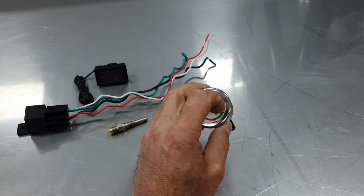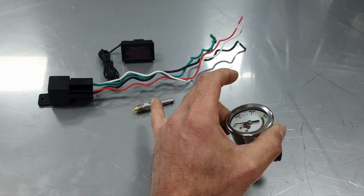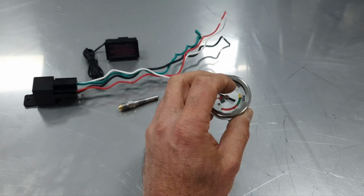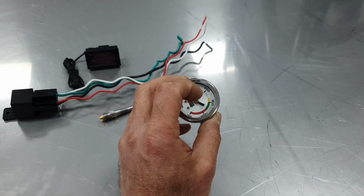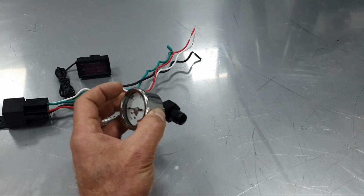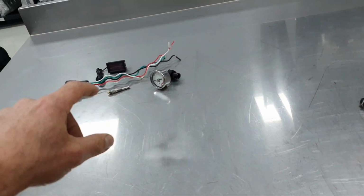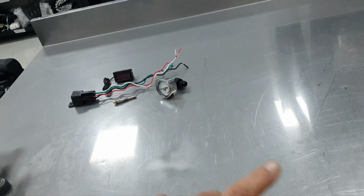So how much are you going to go down? As an example, you're going to go down to 700 psi, so we don't spray so much. That's the thing. You start with 850, 900, and you go down to 700. As an example, it's going to be a short run, so that it doesn't kick in and start warming up the bottle during acceleration.